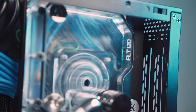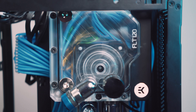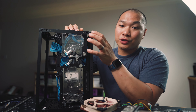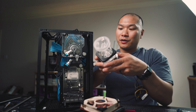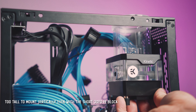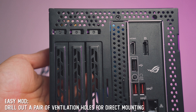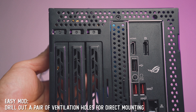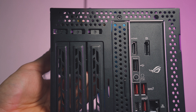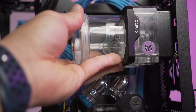The reason I like this style of flat pump res for the case — especially the EK FLT style — is because it's quite easy to ensure that the pump is topped off. The pump sits lower in the res, and if you don't fill it all the way, you should still have no issues. With a more traditional cylindrical pump res sitting at the top of the case, it's going to be really tricky to bleed out. Fill level is critical to getting it to run properly, and you almost have to fill it 100% for there to be no sound. A unit like the EK Kinetic will need about 75 millimeters of clearance to run properly. While you could mount it through the holes in the back, I don't think this style is as optimal — try to get it as low as possible.